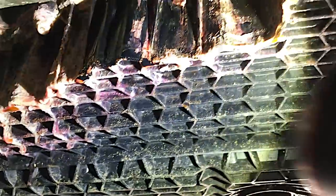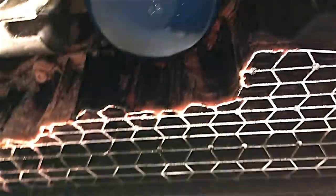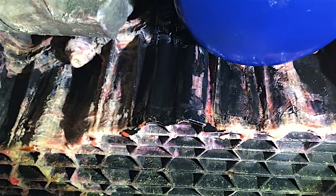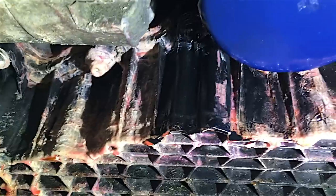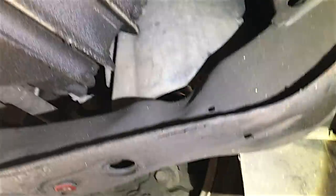That is your engine EGR valve that's leaking. Now, I already know about this valve, but it's running from higher up where the EGR valve is, and your oil filter would normally be covered in coolant as well. So I'm going to put a new EGR valve on this engine after I've walked around this. But that's kind of the mess it makes. That has been leaking for a little while. Anyway, I shall carry on walking around.